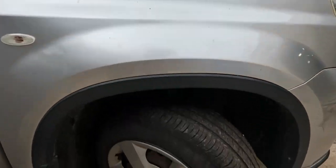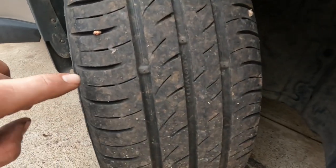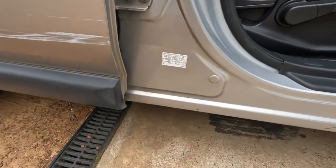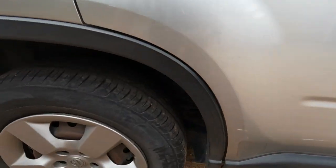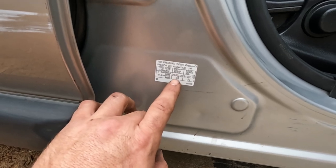Another easy thing to do is double check your tyres. On the sidewall you should be able to see a little arrow indicating the wear limit — go from there across your tread and you'll see a little wear indicator. If the tread is down to that, it's advised to get them replaced. For tyre pressures, I'd advise checking in the morning at a servo. Check your tyre size — it's on the sidewall. Here we've got a 215/65R16, so we run 33 psi front and 30 psi rear.